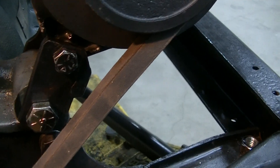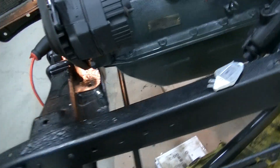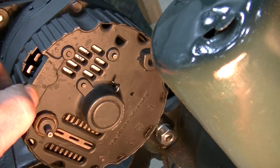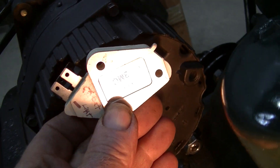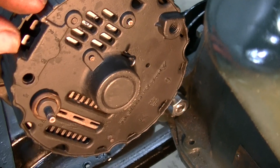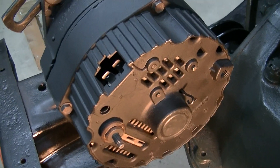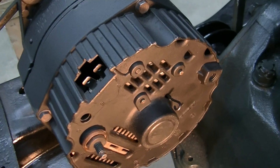When it comes to the actual wiring of the alternator, you'll notice a terminal 1 and terminal 2. This is the voltage regulator that's inside. Terminal 2 gets battery voltage, so that terminal with the harness plug can come right back around here. Terminal 1 either needs a resistor or has to go through a generator light — it calls for two to six ohms — and you can use any bulb that measures in that range as an idiot light. That one would be switched with the ignition switch.